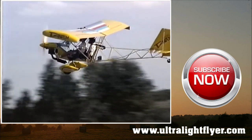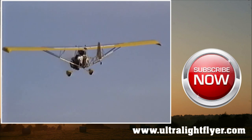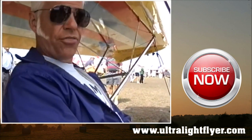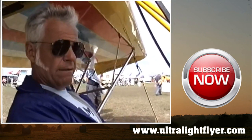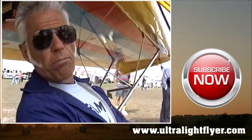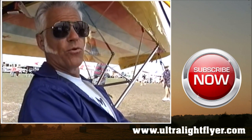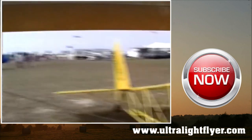What about the speed on this airplane? We're using a 503 dual carb. We're well within the 496 pounds for your two-place trainer. With the big chute on it, and the wingtips and the wheel pants and the brakes, it went up from about 385 — we're sitting at about 435 with this one all dolled up. It doesn't have to be that heavy. With the 503 and two people? With two people on it, it would probably perform like a single place with a 377. Your in-flight weight is going to be up considerably. We have a 500 pound useful load in this airplane at 4.4 minus 2, which is why we've got juries on it.